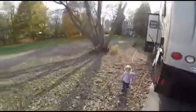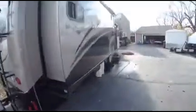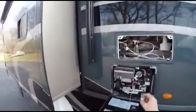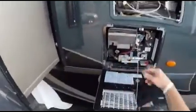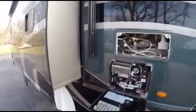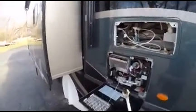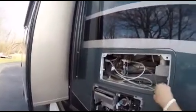You can see here what we did before we added the air is we opened up our plug for our hot water heater, and that's right here at the bottom. You can see it gurgling because the air is going out and it's purging all of the water out of the hot water heater. I always carry one of these wrenches. It's a 15/16 wrench. The water's coming out here, sweetie. And I always just leave that right in the compartment so I always know where it's at.